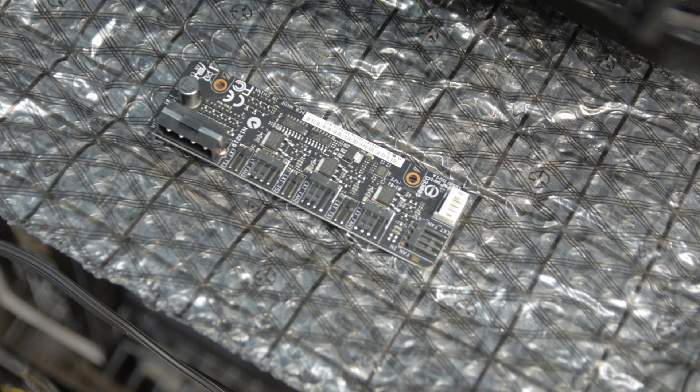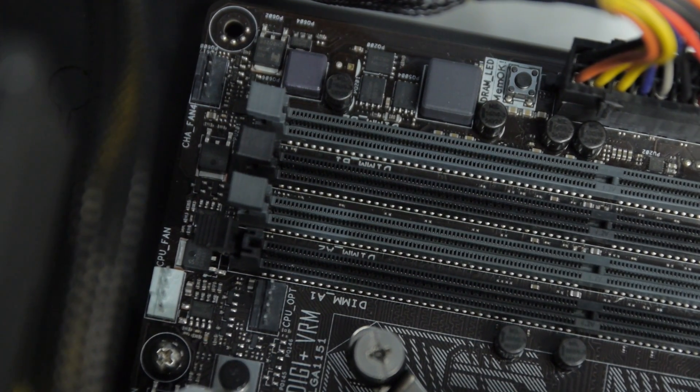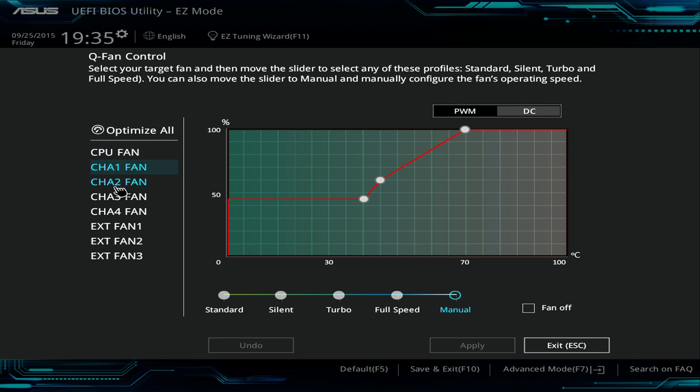The Z170A does not come with the fan expansion board, but you can buy it later as an accessory to control even more fans. In terms of fan control, this motherboard actually has seven fan headers with one dedicated for water pump control — full DC and PWM control on all of them. ASUS has really outdone themselves in the UEFI fan control. One thing people complained about previously was that fan speed didn't ramp slowly between presets. You can now pick that in the UEFI — choosing whether to ramp over 30 seconds, five seconds, or immediately. That feature is on the Z170A, Z170 Deluxe, and other boards in the channel series.